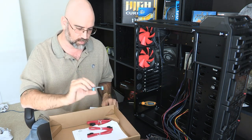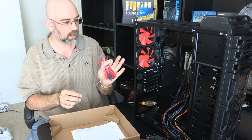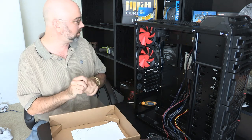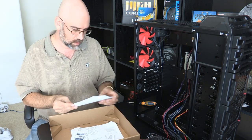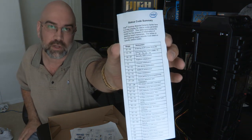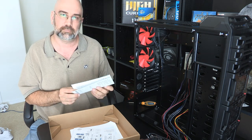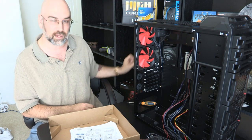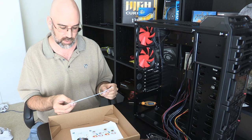Intel drivers — this is if we were going to SLI the video cards. And here are my SATA cables, which are kind of short, so I may have to move one depending on where they are on here. There's also a quick reference for status codes. When you're putting a computer together, it should beep just once whenever you boot it up. If it doesn't, it means something's wrong. These are status codes, similar to POST codes. There's a little LED readout on the motherboard that's going to tell me something if I've got something wrong. And then there's a sticker, which I can put on the inside cover of the case so I can refer to it in the future.